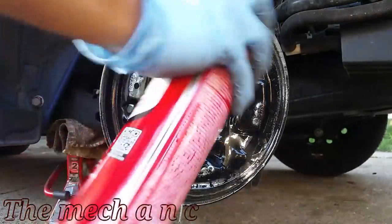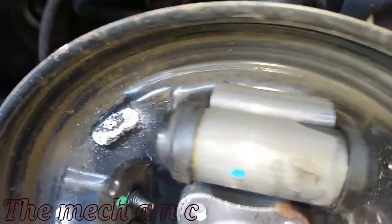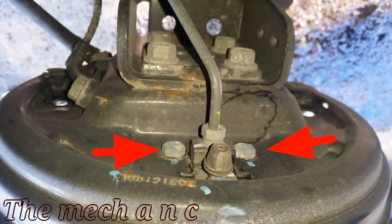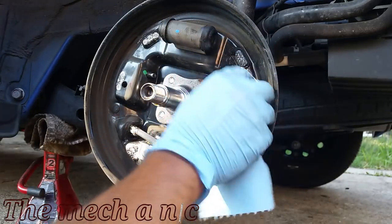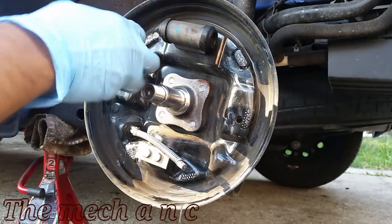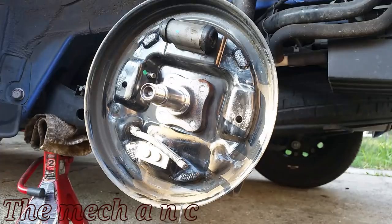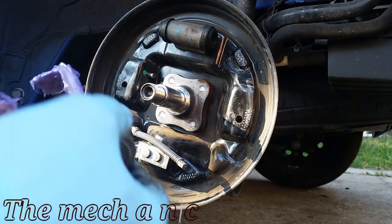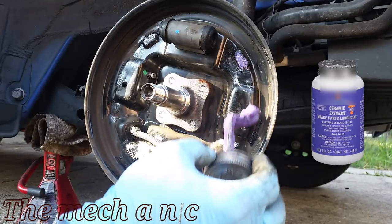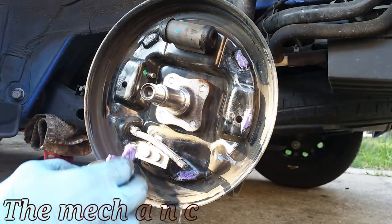If your car needs a wheel cylinder, right now is the best time to do it because you have access to everything. It's this centerpiece right on top — to remove it you just go behind the backing plate, remove the two bolts holding it in place, and remove the brake line in the center. You're going to see me putting on my old brake components because my car only has about 15,000 miles on it and the brakes still work great. My brake parts cleaner didn't remove the grease, so I went at it with a shop towel — that grease is there to prevent brake noise, since the brake shoes slide back and forth.